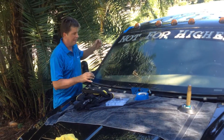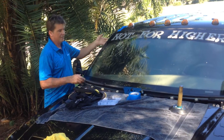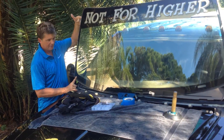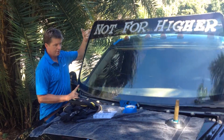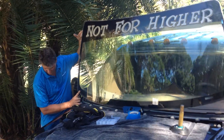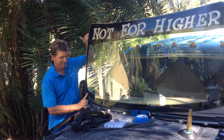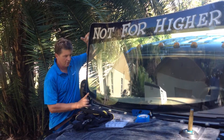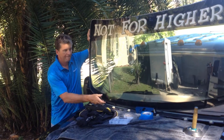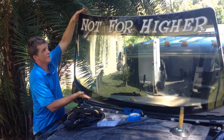However, I think it's easier, even if I'm setting from the side I'm not used to, to let the tool manage all the weight. I'm holding this windshield with two fingers — the tool is balancing the weight. I'm not struggling at all. I'm standing on a plank suspended on two buckets because this truck is so high, so the weight of the glass is not trying to pull me off the bucket or pull me into the fender. When I roll it, you see how easy that moves? It's smooth — smooth action.